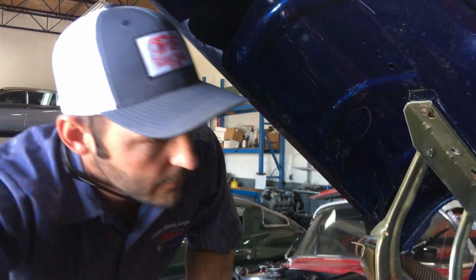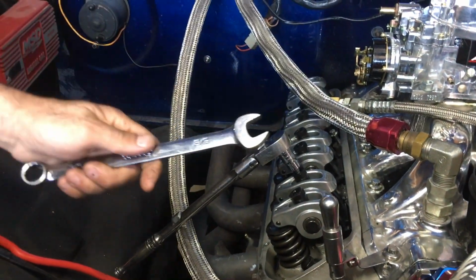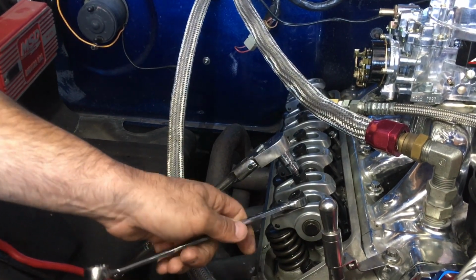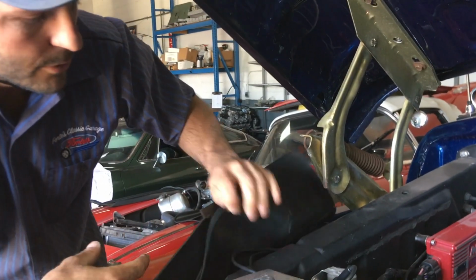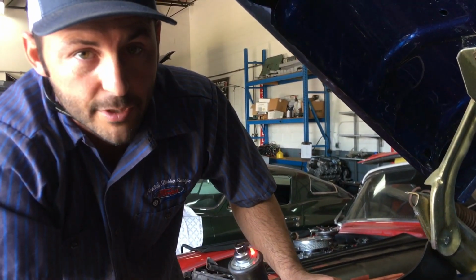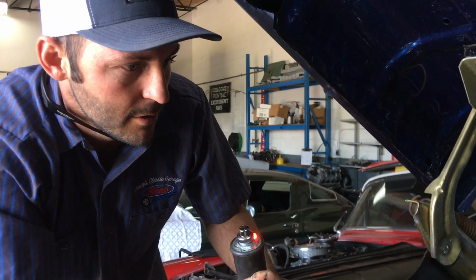You can do a whole side at a time, whereas the book I think has you going all back and forth while you're moving the motor over. So you need an Allen in this case for the center locking piece, and then a 5/8 wrench for the adjusting nut. And you're gonna need a bump starter, or you're gonna have to turn it over by hand manually. So that might be an option for people who have it out.